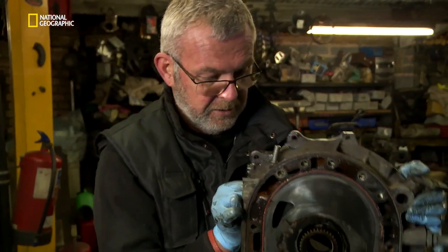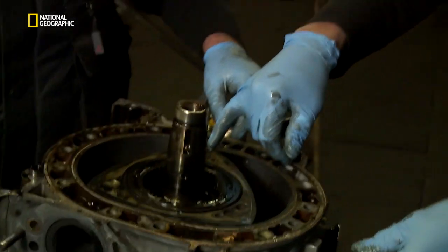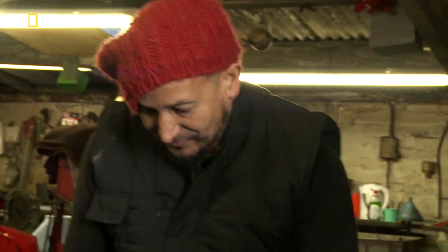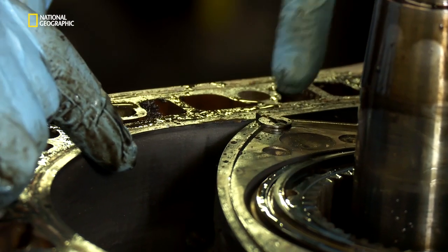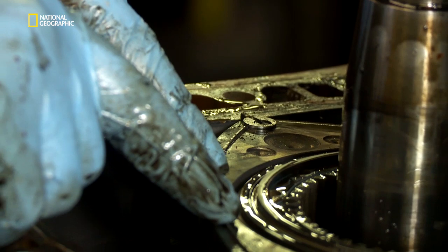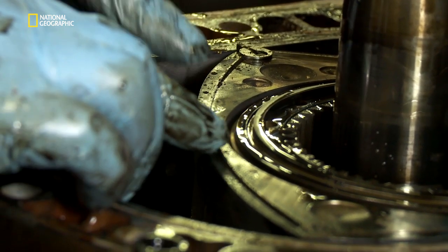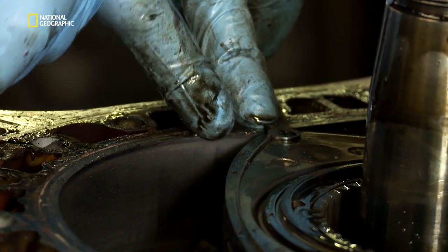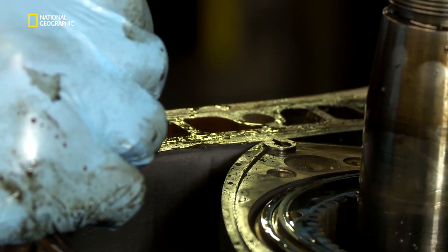We'll take that plate off — this is cool stuff. This is my first ever rotor. These here are the tips. You've got what you call a sealing grid, which acts the same as a piston ring would on a conventional engine. The small circle here is what we call a corner pin — that moves up and down on a spring slightly underneath it. Same on the side seal — again you've got slight movement, just a little bit of play. And then there's the apex tip seal, which in effect is the piston ring — that's the thing that just pinged out. They're one-use only, we never reuse them.